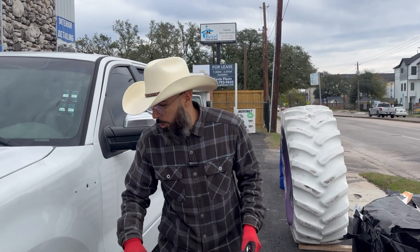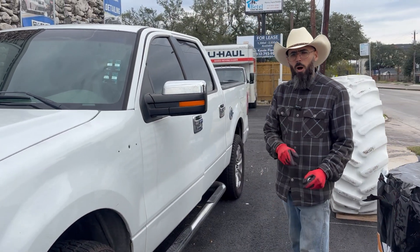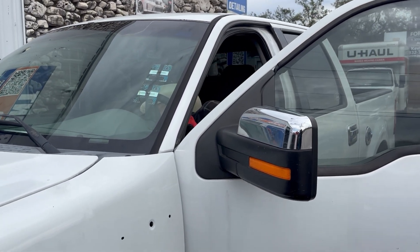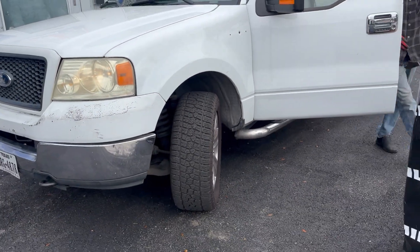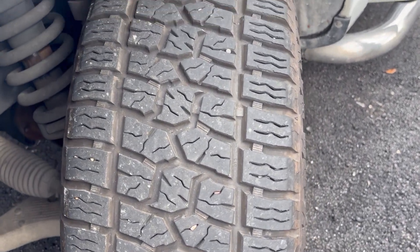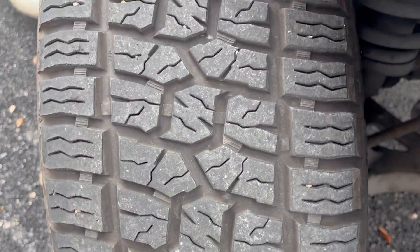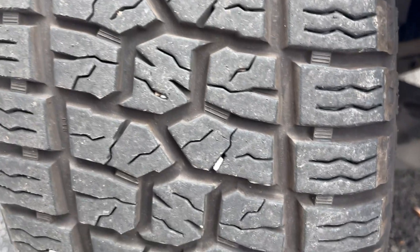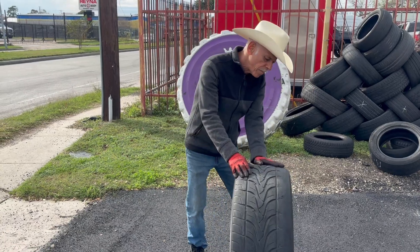Let me show you how to look at your wear bar on a vehicle where the tire is mounted on a small car — it's not so easy to see. Here's what you do: fire the vehicle up and turn the tire all the way to the left to look at your driver's side. Now you can see your tire and your wear bar much better. Turn it the other way for the other side. No excuses for not knowing what your tire looks like.